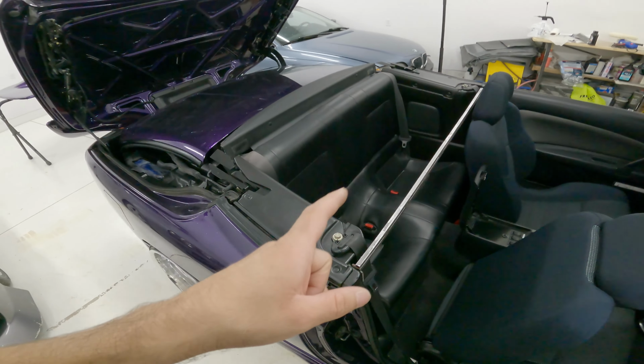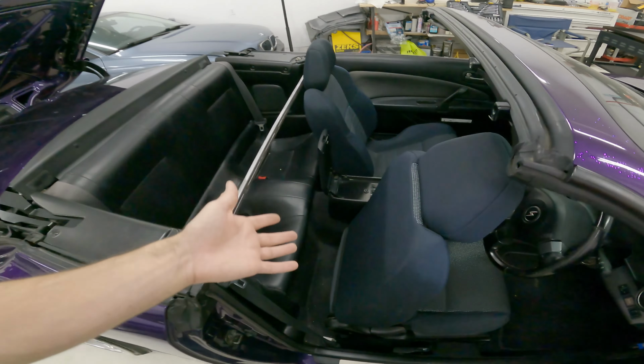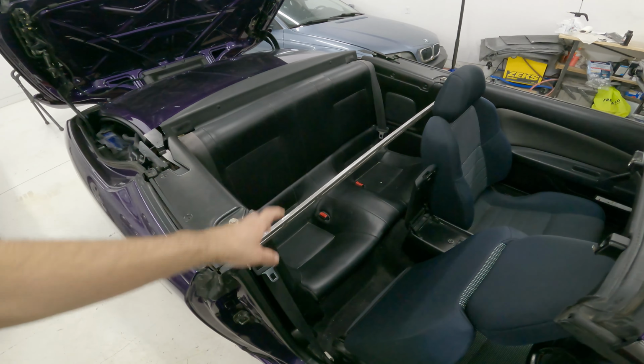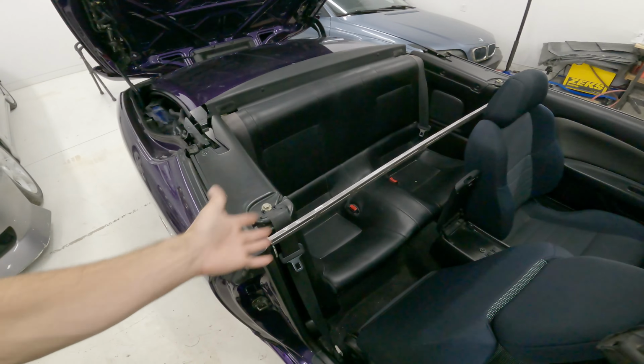And then I can do the second scariest part, which is drilling a hole through each hump on the speedster top, which doesn't really matter because it's hidden by the seat basically at all times anyways. But yeah, gonna drill some holes into it, mark it out on that, drill that, put some riv nuts in there. Then I'll take them back out, just spray bomb it flat black, whatever. You don't see it, but just so it's not bare metal.